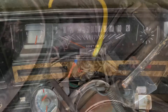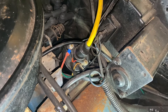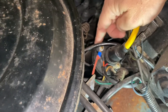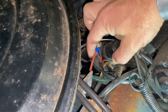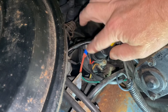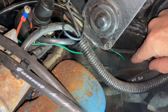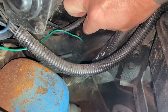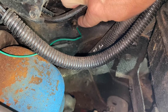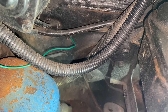Now let's look at the wiring. I'm going to start out here at the ignition coil. Right here is the negative side of my coil — I took that nut off and I've got an eyelet. Make sure you use shrink tubing when you do this and you solder and crimp. I ran the green wire here; it's coming down towards the firewall through a grommet that was not used. So I didn't run metal to metal and I didn't have to drill another hole. It runs straight through the grommet and down into the cab.